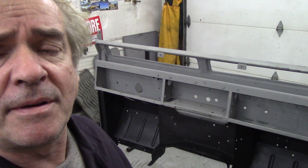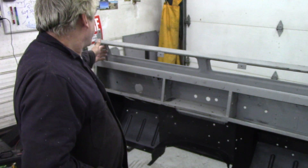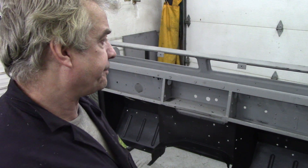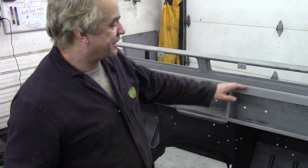One thing I wanted to mention when it comes to repairing these top corners: back in my day we couldn't buy that part — we had to fabricate everything. It's a real pain because you're chasing rust back further and further. I only took this one on because that piece was solid. Once rust is in, it's in. I'd have liked to see a full assembly for the top so you could just cut the old one off and weld a new one on — none of that messing about with little patches.